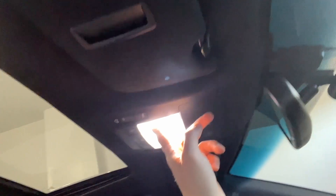That is a lot brighter — click it and it's good. Look at that — way brighter. Look at the difference inside. Night and day. And they also match very closely with the existing reading lights. You can see the colors are about the same. That's the reading lights, and here's the main light — now it's much closer in color. The Yorkum ones are 6,000 Kelvin. Kelvin, if you don't know, is the warmth of the light. A 3,000 Kelvin bulb will be very warm and yellowish. As you get higher, at 6,000 it's a very cool light, and higher still — 7,000, 8,000 Kelvin — it becomes more blue.